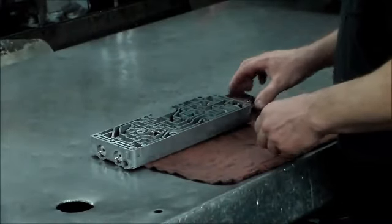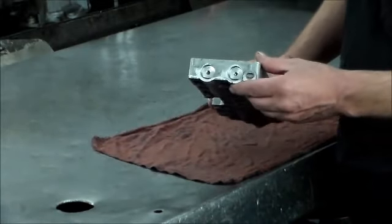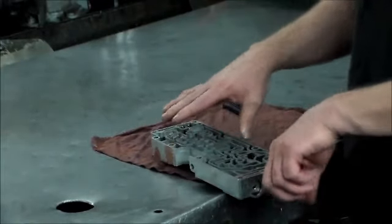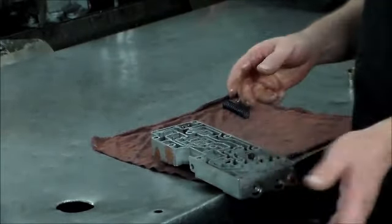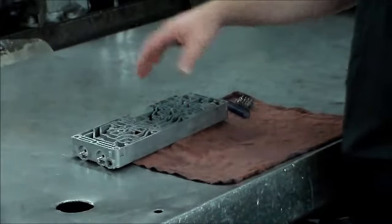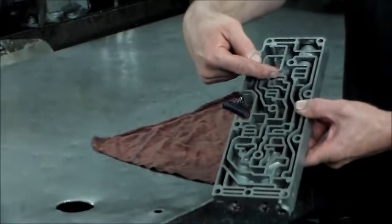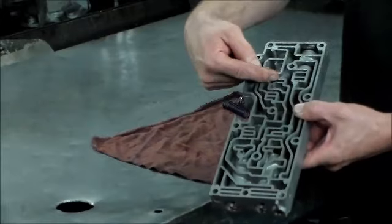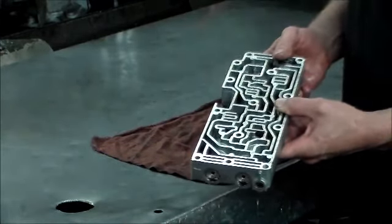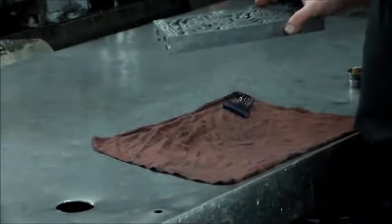That's why I have to take each one of these out, because I do Transgo shift kits. You just pop the clip out, get a valve body bolt, screw it on the end, hold it with a plier and give it a tap, and it comes right out. So definitely check these springs. This one, I believe, is the second accumulator, and these are third and fourth here. So that's definitely something to check when working on these units.